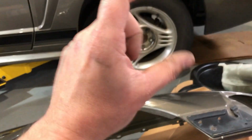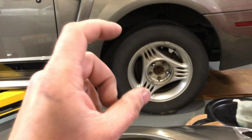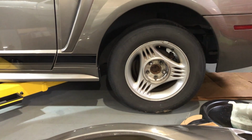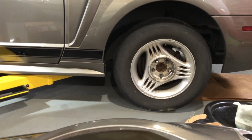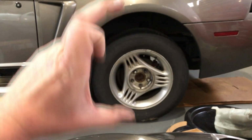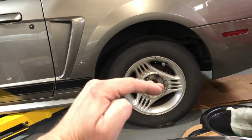He cut the ends off and put 9-inch end housings on, and we're going 35 spline axles on a spool for now. I probably will put some sort of Wavetrac or some kind of more street-friendly differential in it. If the turning radius happens to be that of a Suburban extended cab thingamajig, so if it's bad, I'll work on it. If it's not, I won't care. It has adjustable upper and lower control arms. It has those control arm mounts that are like this long, and it's just a series of holes so you can move the control arms.